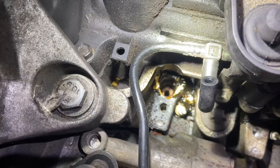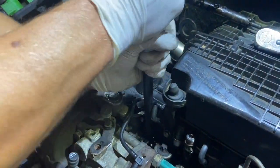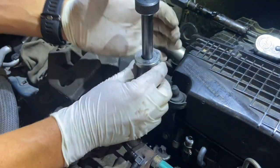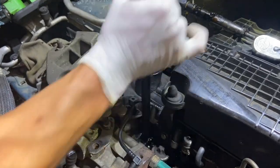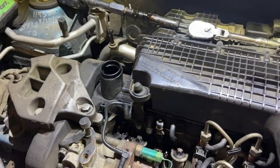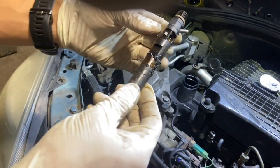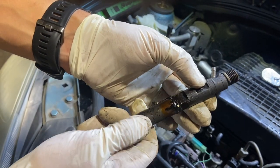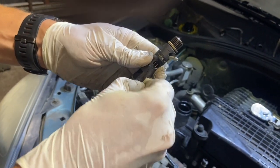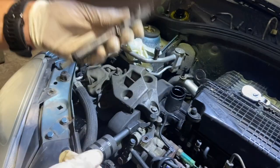Using the puller tool, we thread that into the seal and give it a pull — that's nicely just pulled the seal out. Now, be careful with the injectors: if you're going to take them all out, make sure you put them in order because the injectors on these are coded. There's a little number around the top and they need to be coded by a diagnostic machine to say which cylinder they're in. If you're fitting a new or second-hand injector, always note that code and make sure it goes back in the same cylinder.